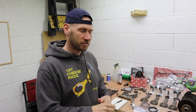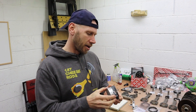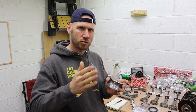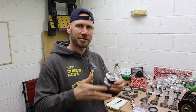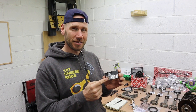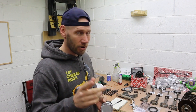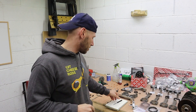As a side note from the last video: when I measured my pistons for piston-to-wall clearance, on my number four piston Martin Emmett pointed out that the deviation in measurement was possibly because I was holding the micrometer, and the heat from my hand by the time I got to the fourth piston would have affected the measurement. I was a bit skeptical, but I came back and measured it — and it's true. That piston is 82.88 mm, exactly the same as the rest. Thanks very much Martin — every day is a school day!